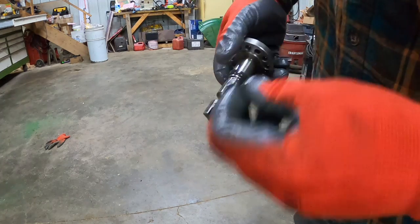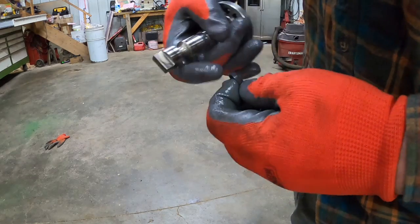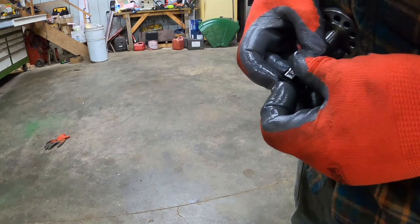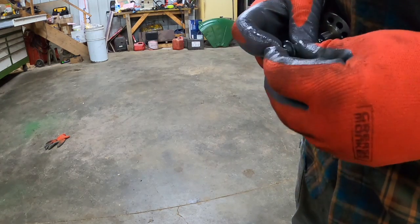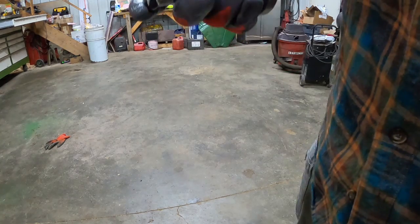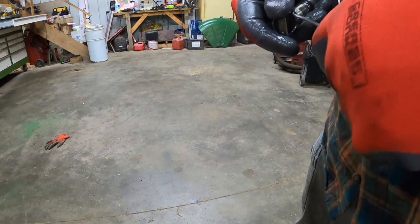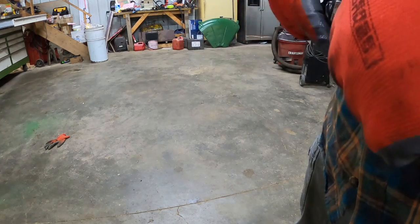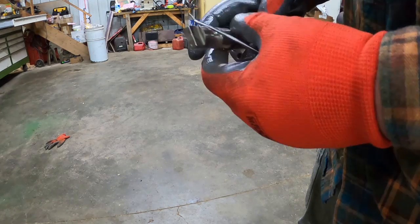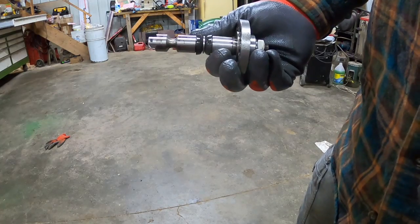It keeps the fuel from going in the engine, and the front one keeps the engine oil from going in the fuel. The pressure of the fuel pushes out on the lip and helps seal it. So if you're getting fuel in the oil, this is a possible contamination point. They are fairly reliable, but they do occasionally leak. There, just like that, she's in the groove.